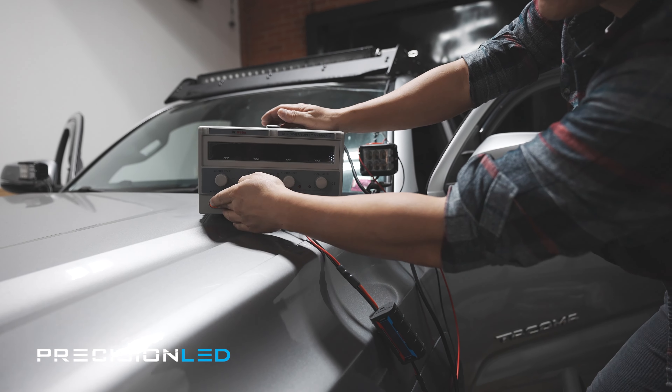What we're looking at here are all of our wiring supplies for the light bar. Normally we wouldn't redo this whole connector — this quick disconnect — since it's already a waterproof connection, but the housing is cracked here. So I figured this is a good example to show you how this whole assembly comes together. The single row black series doesn't have a wiring connector, so we have to assemble it ourselves. We've got 14-gauge wire, a crimp connector, some quick disconnect male and female plug ends. All you need is these three items and a soldering iron. Maybe some heat shrink tubing. This stuff was like maybe $45 worth of parts.